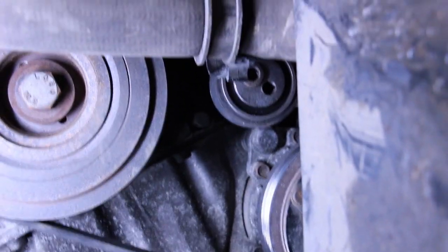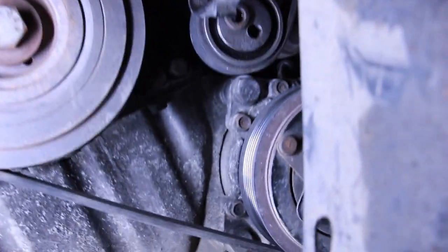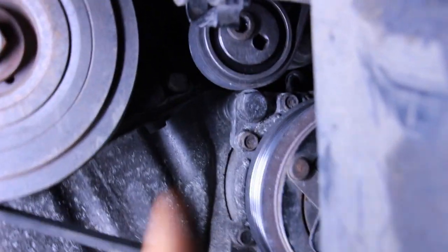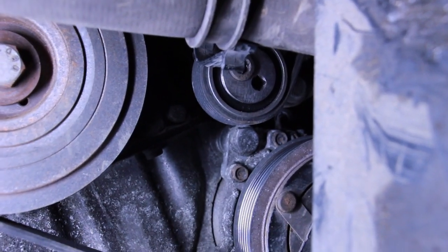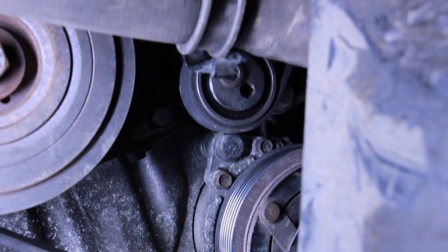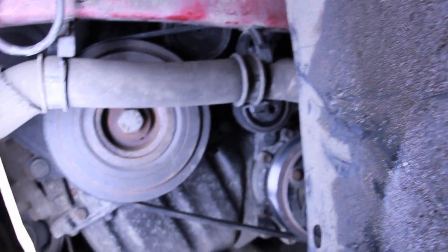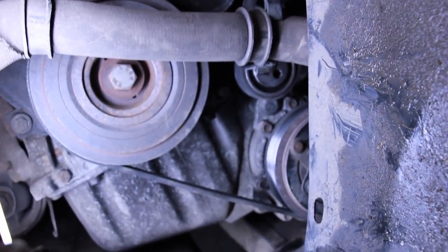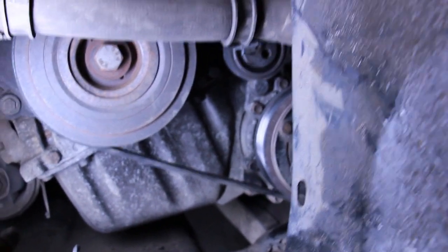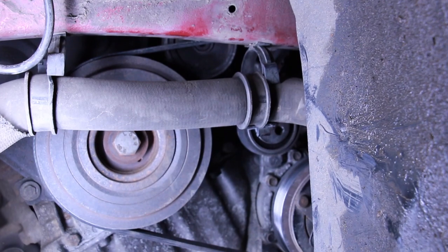And the part number for the Gates tensioner is that, there we go. And there you have a much better tensioner, guide, whatever you want to call it. It does manually tension if you want to just adjust. The belt gets a bit slack over time when the automatic tensioner runs out. And there's always a train here, even during lockdown when no one's on it. But there we go, that's on. Squeak's gone. I think that's a better setup, and there's an alternative for you. They come from Partner 2-litre diesels before they switched over to 1.6s.